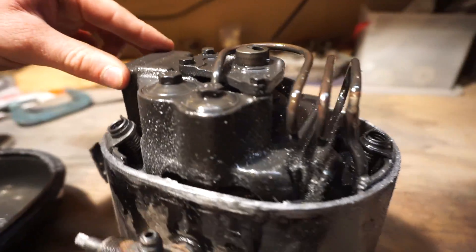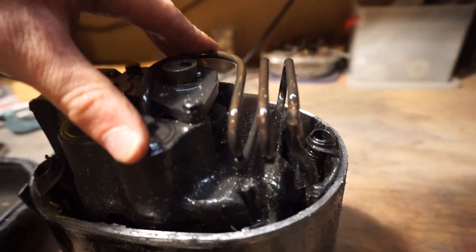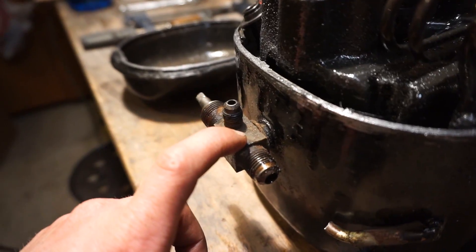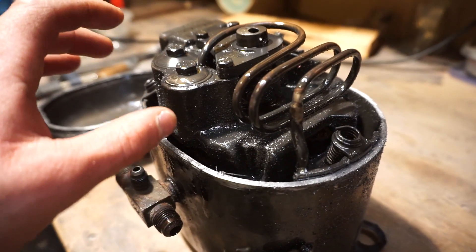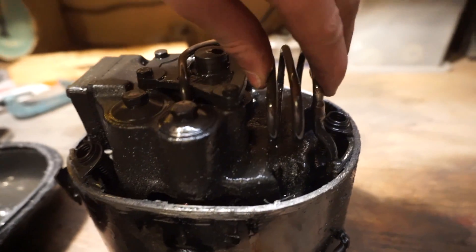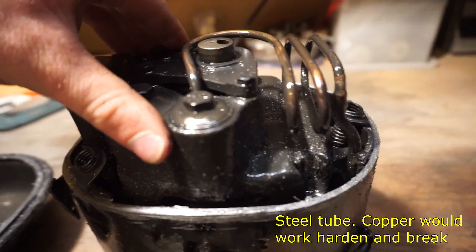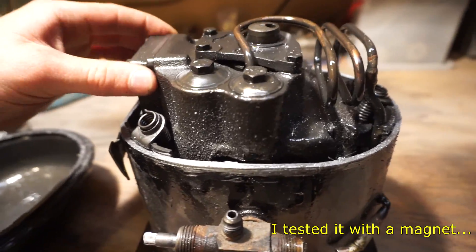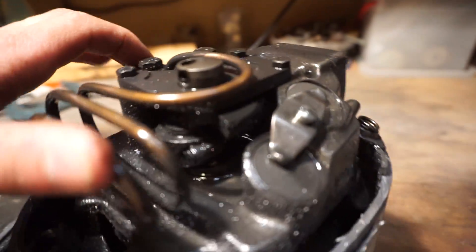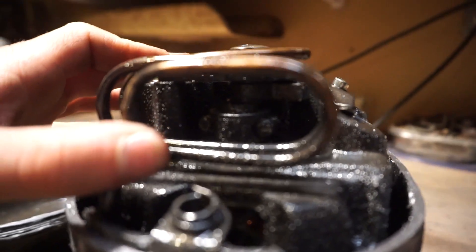As you can see, the whole compressor assembly is actually on springs — there's three springs here that's pretty much all that's supporting it. And this is the discharge tube, so the high pressure side. What happens with the compressor is the low pressure gas comes in here, and then the compressor basically just compresses it and discharges it through this small line here. In order to make a good connection there that won't break, they have this coiled copper tube here so that the compressor can vibrate a whole lot and be quieter.